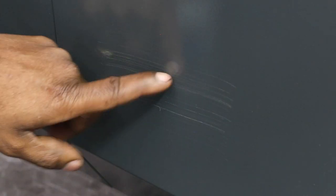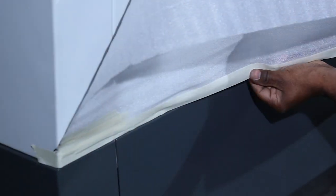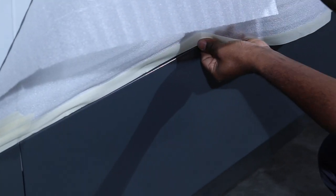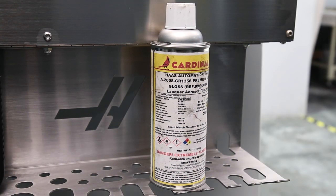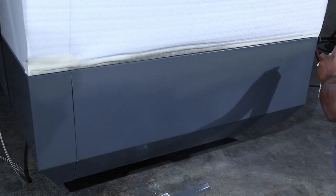If the panel is down to bare metal and rust is present, prep the area by using a piece of Scotch-Brite to remove the rust, then clean the area with soapy water to remove any other particles. Once the area is dry, use a fine grit sandpaper to smooth out the filler. Wipe clean, then mask off the panel surrounding the damaged area and use an aerosol touch-up paint to spray the entire panel with one or more even coats until the repair area has a uniform finish.